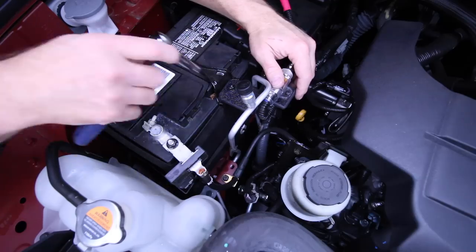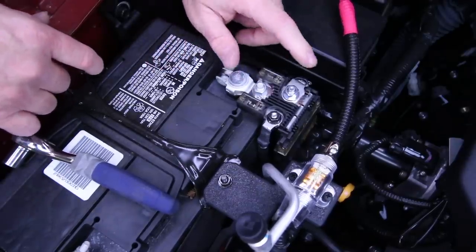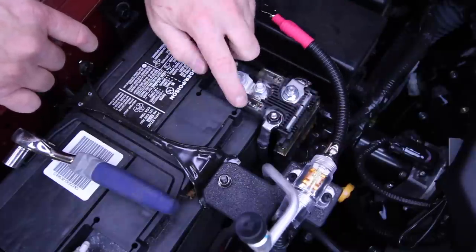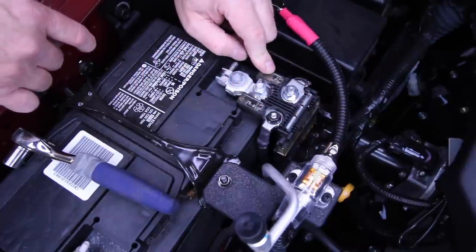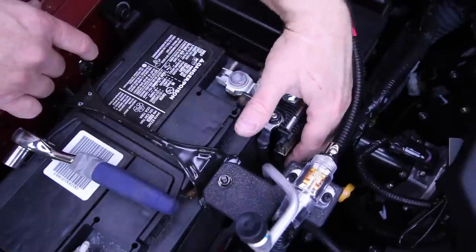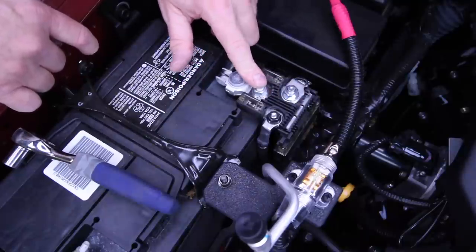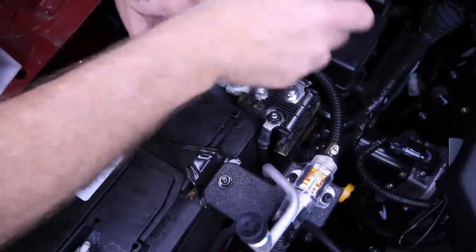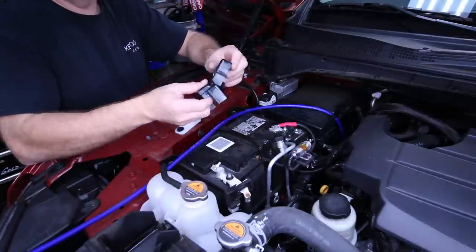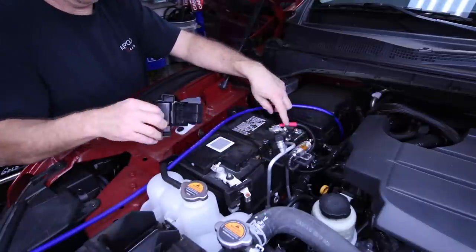You don't have to do that — you can just use the bolt that's already under there. Since we're looking at the battery terminal, let's talk about a few things. This bolt and this bolt are awfully alluring — you might think it would be great to just hook up right here. But these two are fuses for the car: this one is a 250 amp, this one is a 100 amp. The problem is, if you blow either one of these you have to replace the whole module. So even though these look appealing, you definitely don't want to use either one of them. This one is okay and this one is okay. Now, naturally you want to make sure you can put the cover back on, so we're going to cut right here so that it will snap back over in place and allow room for the new wiring.